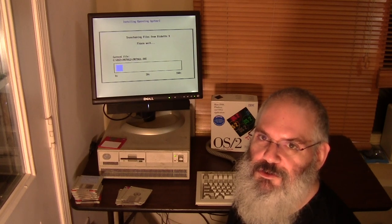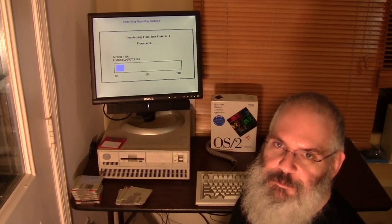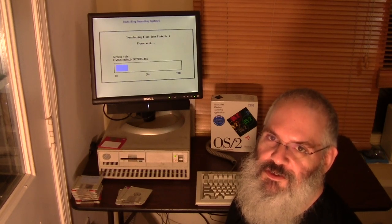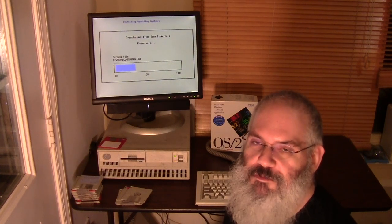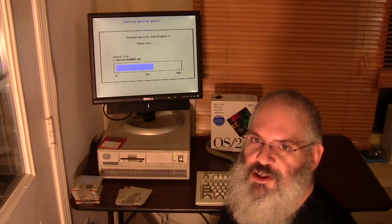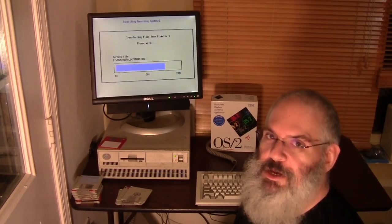The BIOS is what allows the computer to start. It's a location in the computer's memory that tells the computer what to do when it powers on. When a machine powers on, the CPU resets and goes to a reset vector - a location in memory. On most PC systems, that points to the BIOS, which tells the system where to look: floppy drive, hard drive, CD-ROM, USB device, etc. We've recently started replacing BIOS with EFI, the Extensible Firmware Interface, which is just a more advanced form of BIOS.